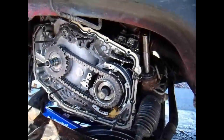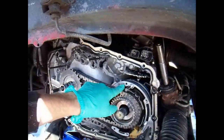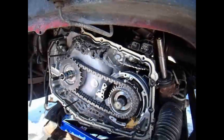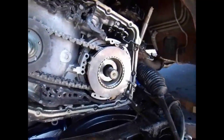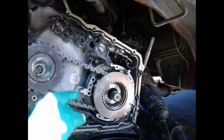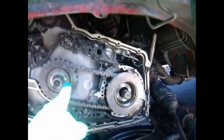Alright, I got that piece on there. Now, one thing you'll want to do is make sure that the hub here is lined up. If it moves or whatever, you'll need to get it lined up. I've got these guides here, so whenever the channel plate goes on there, it will line up correctly in the right spot. I got my clutches and steels installed correctly. The thickest one goes all the way in the back, then it's a clutch disc, then another metal plate, a clutch disc, and then a metal plate — so it's got two clutch discs and three metal plates. The thickest one goes furthest in the back.